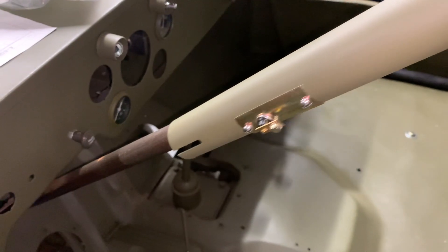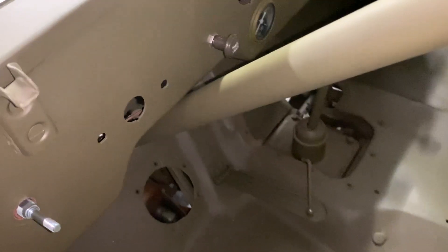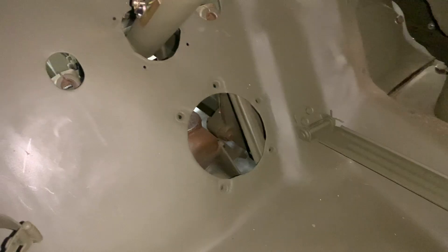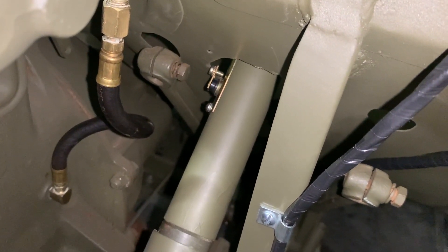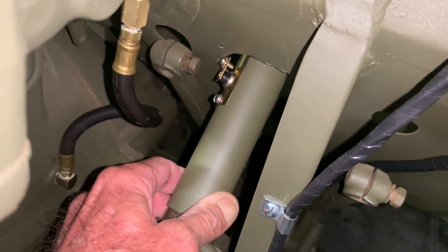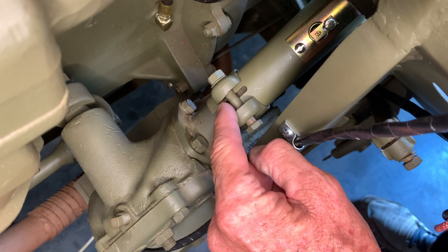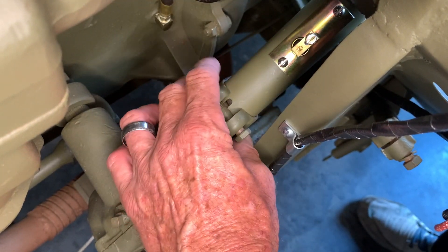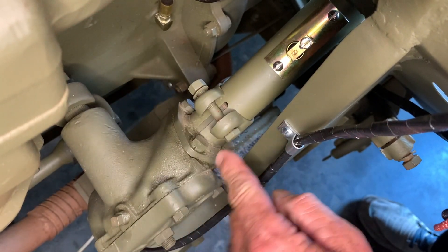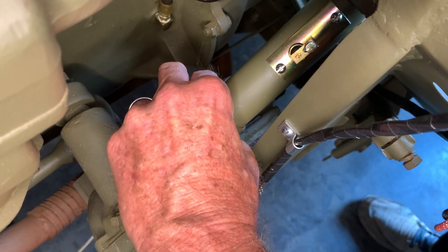Next, go back inside the tub and gently slide the tube down — you don't want to catch that brush on the way down and damage it. Coming down toward the bottom, something a little magical happens that confuses some folks: the tube stops just before reaching the top of the steering box. The inside contact brush is hitting the beginning of the ring and stopping it from going all the way down. What you do is position the clamp about a half inch up, then pull up on the brush spring and it'll drop down into place. You may need to wiggle the two back and forth to get a nice fit.